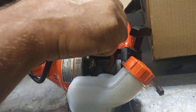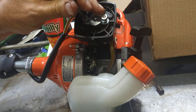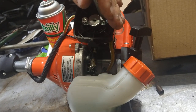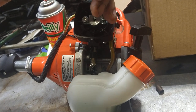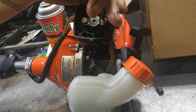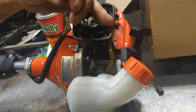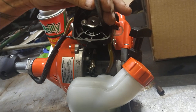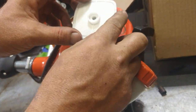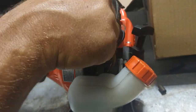Make sure you don't tighten one side before you get the other side started. You've got to make sure you get both sides started before you snug it down. Once you've got both sides started, snug one side down and then go to the other side and snug it down - like that. Now you can tighten. Just like that. New air filter in, then the air filter cover back on.